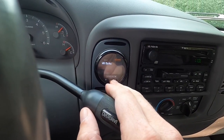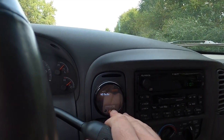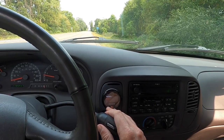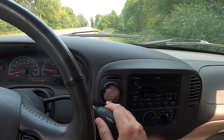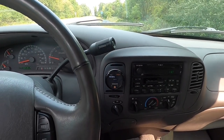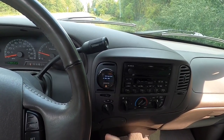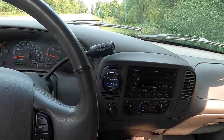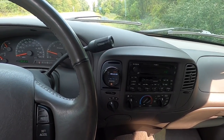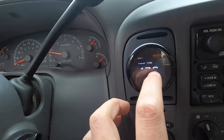We're gonna need to adjust the duty cycle. It's 65 degrees out, so let's start somewhere around 70 and see if that gets us close to our 12 PSI mark. But like I mentioned, we're just gonna roll into it here real quick to see what our AFRs are doing before we step on it, because I have not boosted 12 PSI before. I just want to make sure we ease into it - I don't want to turn it all the way up to 100 percent and rely on that wastegate opening to save the engine if we hit boost cut, even though I've never had any issues with it opening when we hit boost cut. Just better to be safe than sorry. I'll change AFR to the main number here, and boost is the small one up top.